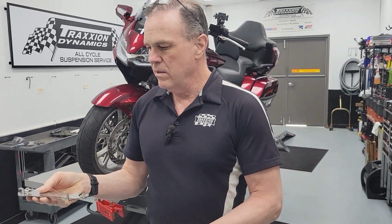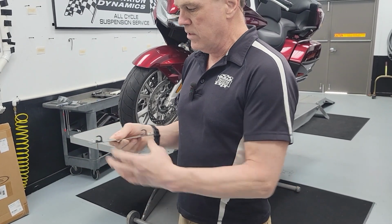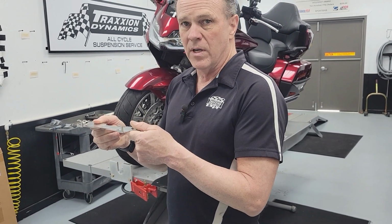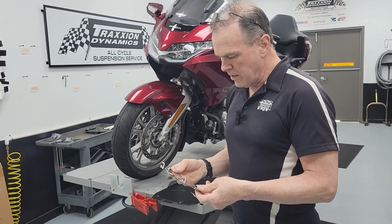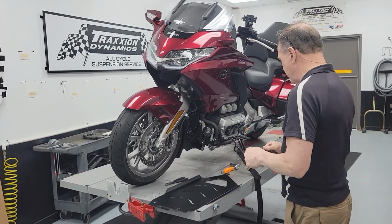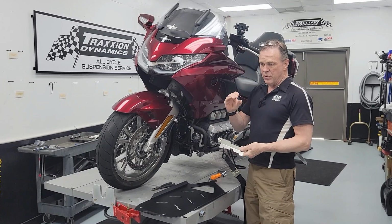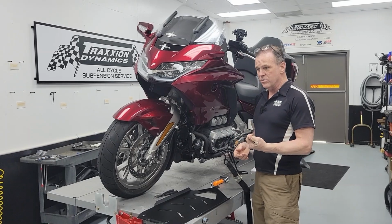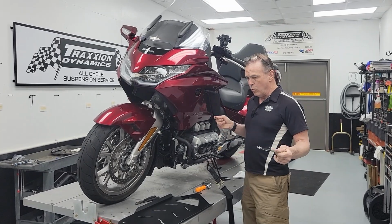The front bracket, you loosen the 2 engine bolts up and kind of back them out, the same 2 that the traction engine guard uses. And this one, you can just hook them up onto the bolts. They've got some slots cut through it, and then tighten the bolts back down. But this bracket's stainless steel, and it seems pretty solid. Again, not on the order of magnitude of the half-inch billet aluminum ones on the traction guard, but of the other bracketry, this is far stronger than the strap style one.